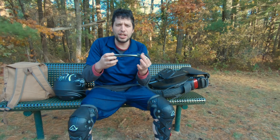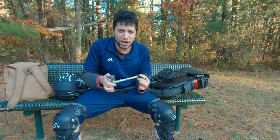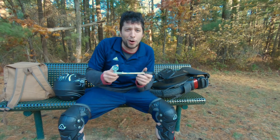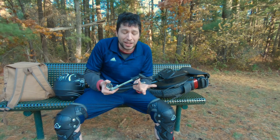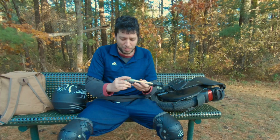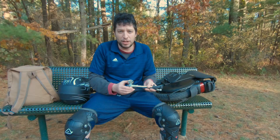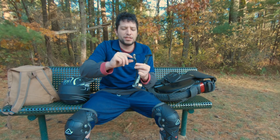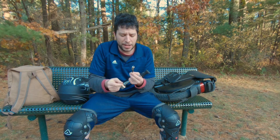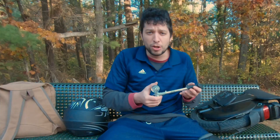Let's go over how this pump works. The little shock pump that comes with the machine does not move much air — it's designed for putting a little bit of air into a small tube. Don't try to use this on your tire; it'll take you two hours of pumping. It's made to get up to really high pressure. It has a little release valve, and on the end of the pump is a lever which moves a piece inside up and down, so you can lose almost no pressure when pumping up the system.